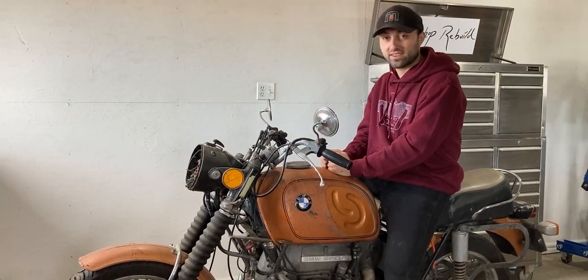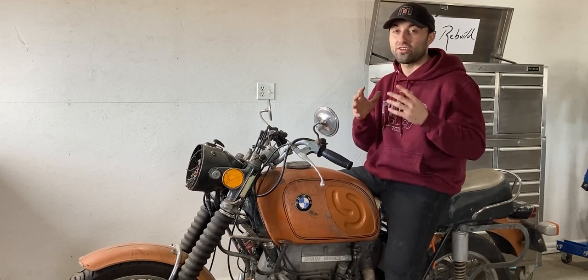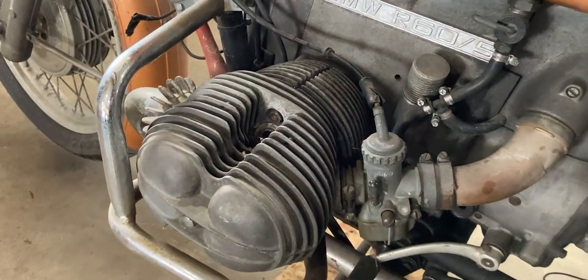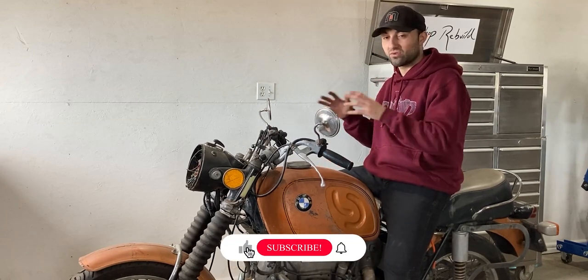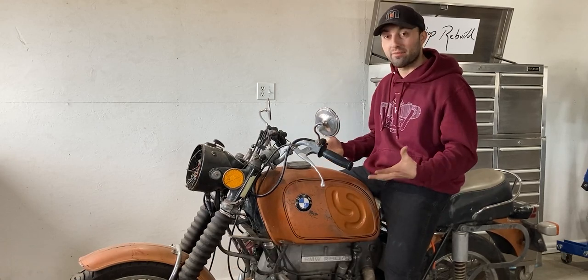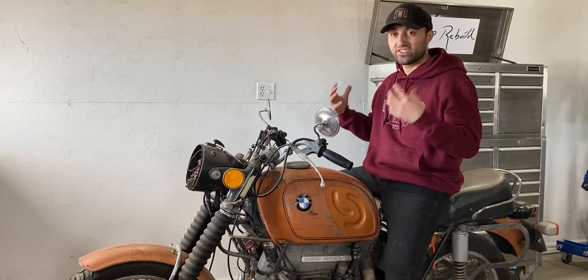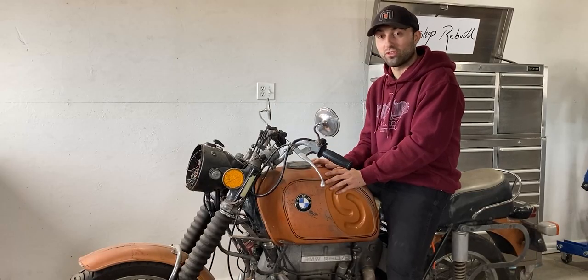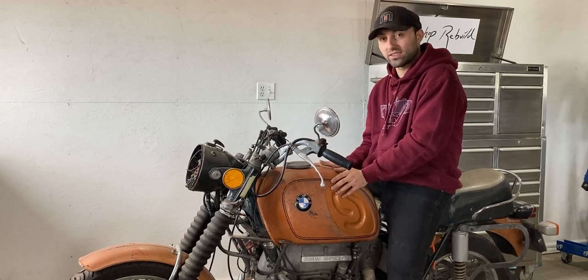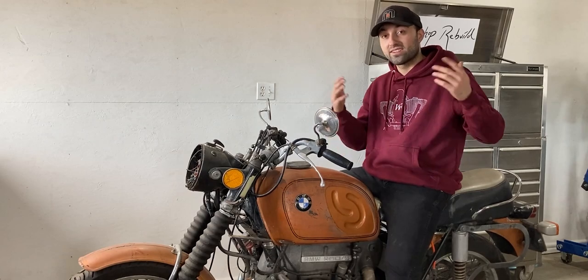As many of you know I'm not afraid to tackle a project like this. The cosmetics are one thing but the drivetrain is super important especially if you want to go on a longer trip. The values that I received today are not looking very good, especially on the left cylinder — we have very low values which are in the poor specifications. Now I'm going to have to have a good look at the left cylinder, but if I'm already looking at the left cylinder I might as well just look at the right cylinder too. If I have to buy one head gasket I might just buy a second one as well — they might even come in a pack of two. I might actually even just tear into the engine to make sure everything is good: the oil pan, the crankshaft, the camshaft. I really want to make sure that this engine is tidy and to specifications. This BMW has just over 93,000 kilometers and it would be a shame if this motorbike wouldn't make it back on the road. I will tear into the engine, have a good look at the transmission and all the other components around the drivetrain. Once that's done I will have a look at the cosmetics — if you guys are interested in that, stay tuned for an upcoming episode.